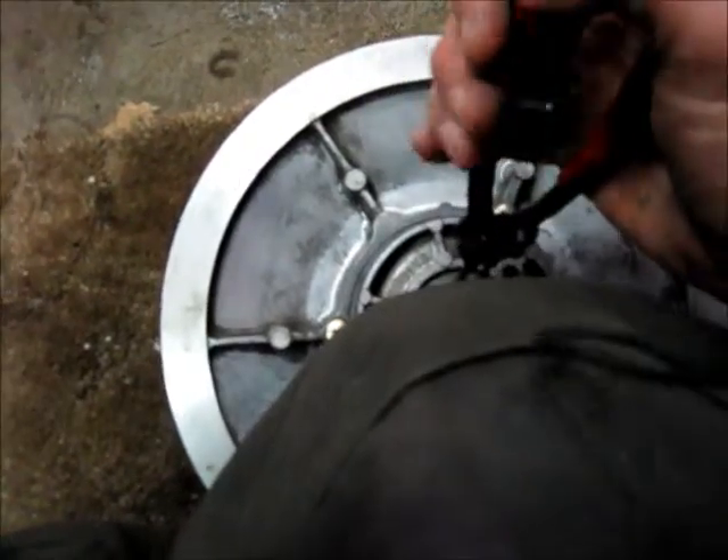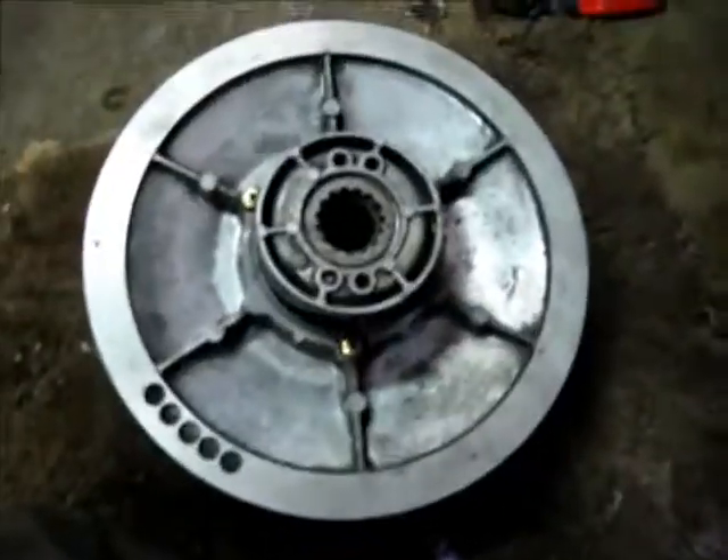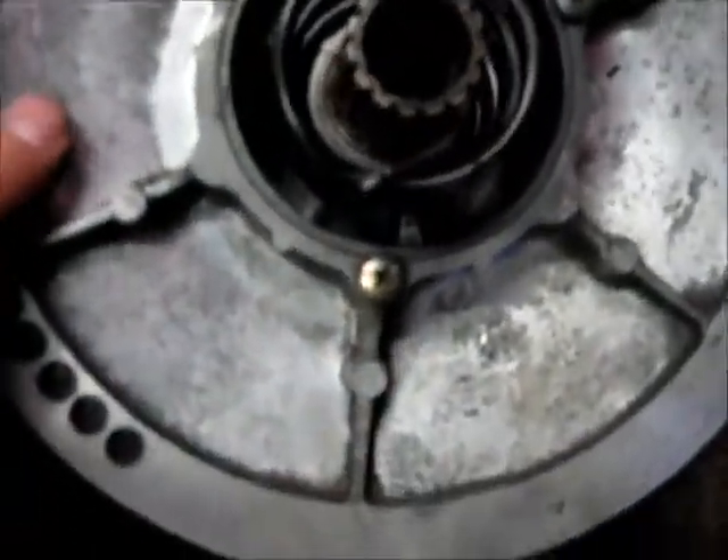What I do is I get my knee on here and just give it a little nudge. So the snap ring comes right off. Slowly release the helix — it is under torsional pressure. Here's your markings: slot 1, 2, 3, 4, and then you have A, B, C inside here.